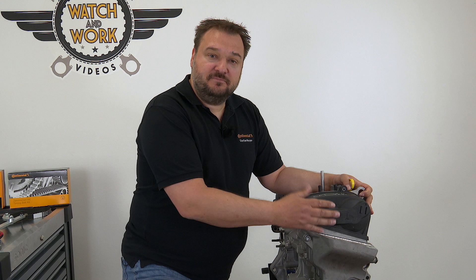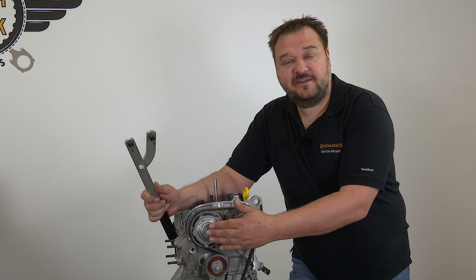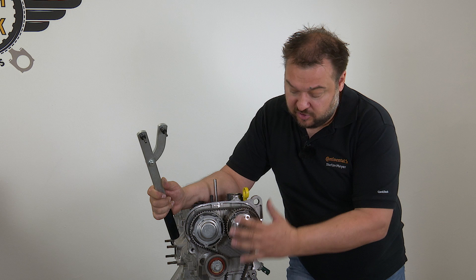The timing is now set correctly, so we are ready to expose the timing belt. Remove the timing belt guard and the belt pulley, then slacken the timing belt. Remove the cover and the sealing screw, then undo the camshaft bolt behind it using the counter hold tool. Once this is done, loosen the tensioner pulley at the bolt, slacken the timing belt with the help of the tensioner pulley, remove the timing belt and replace the components.